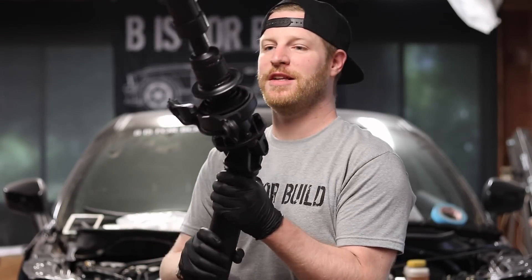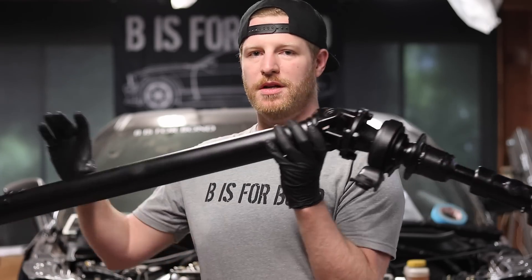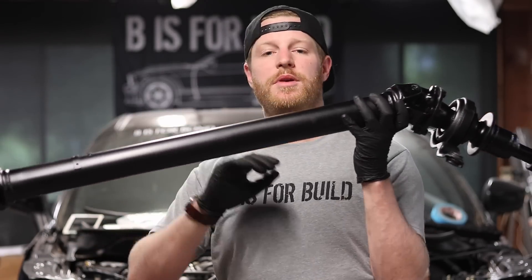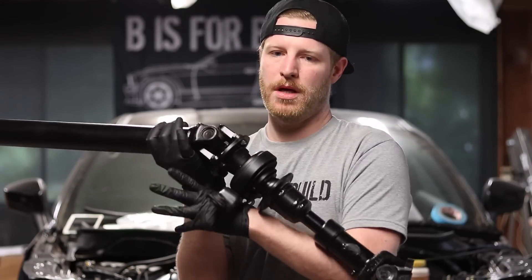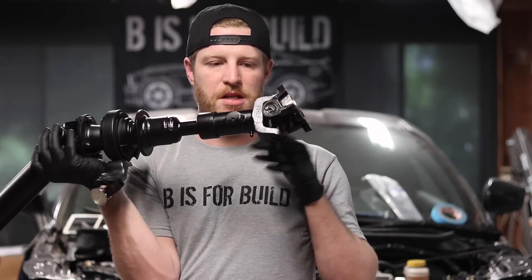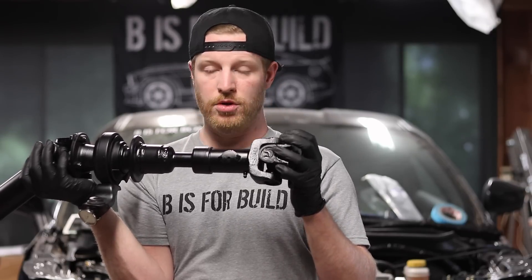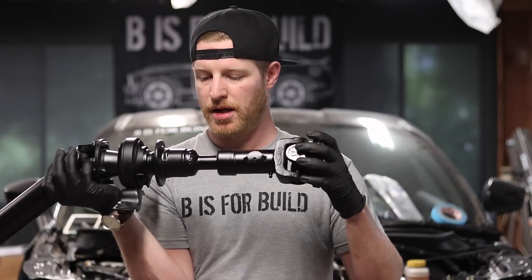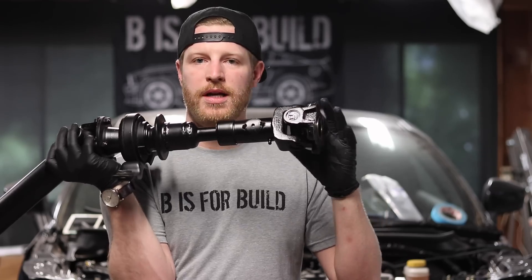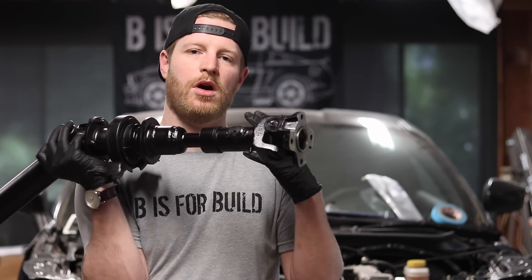Back in the shop with my fancy new driveline. It's BRZ on the back end — standard BRZ driveline — then we have our middle carrier bearing, and then it goes to — this is where it gets tricky — the new stuff we just built to go to the new transmission adapter that I had made. The original one has a slip yoke.